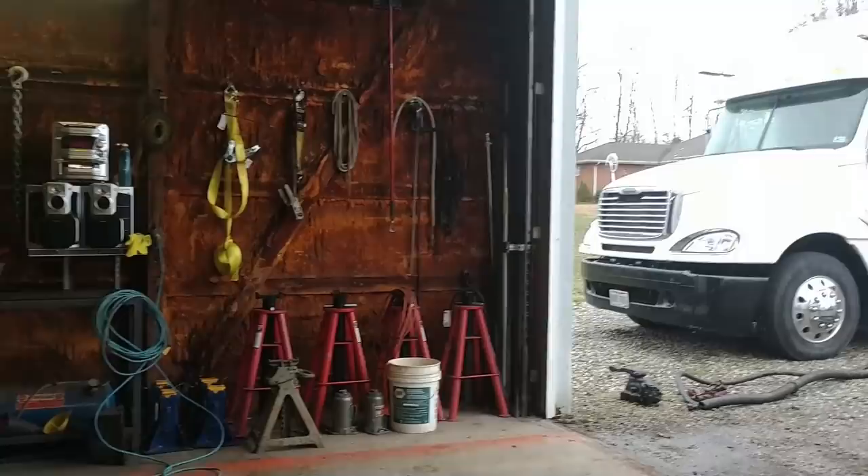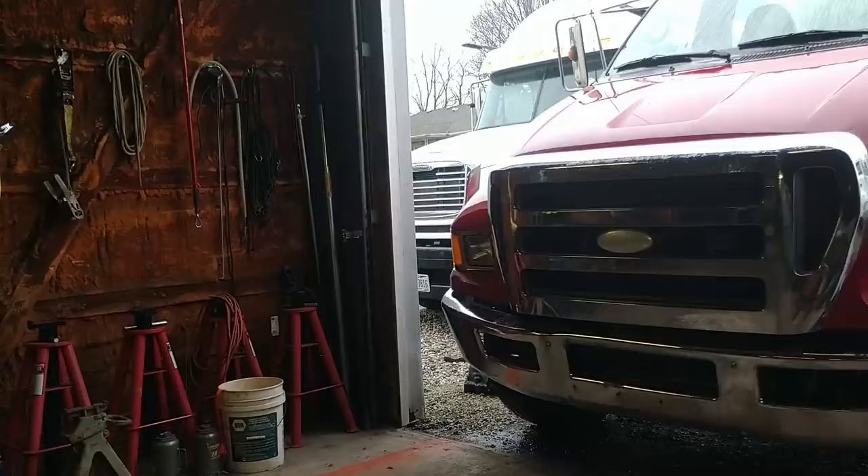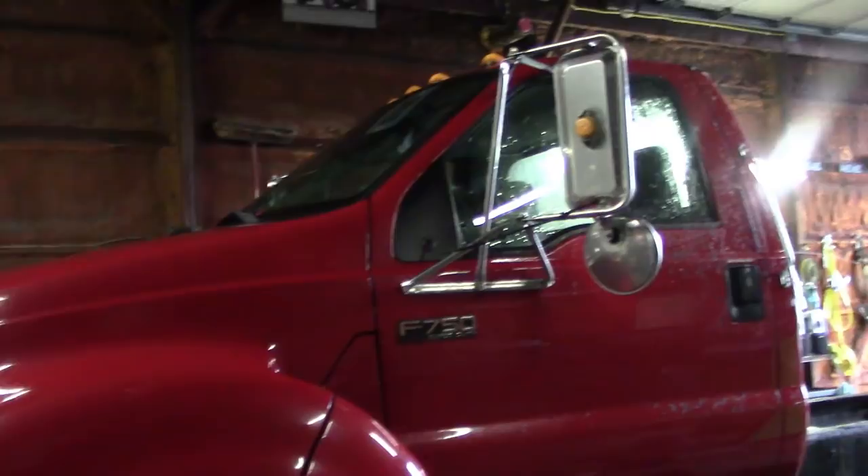The frame in front of that is in good shape. I know a lot of guys are going to say it's been hot, it's not tempered. Listen — it didn't get very hot on the section of frame I'm using because the factory paint's still there. The factory paint would have came off pretty quick, so I'm pretty comfortable with that. We're going to do some other stuff to this truck anyways, so we're going to be in good shape.